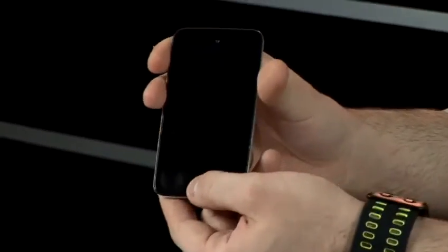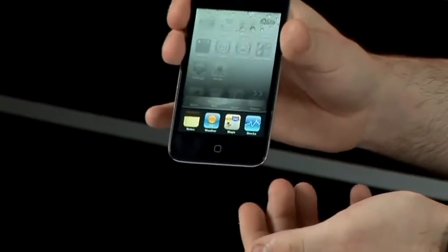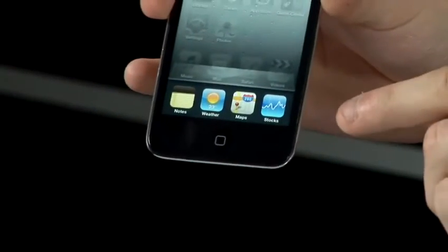With the iPod Touch, if you've downloaded any apps recently, they may be the culprit if it's freezing a lot more often than it used to. Apps sit in memory and stay open for a while. What you can do is unlock the iPod and double-tap the center home button — you'll see all the apps that are currently in memory.